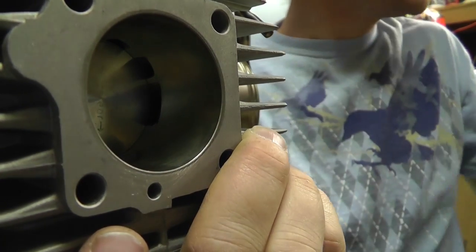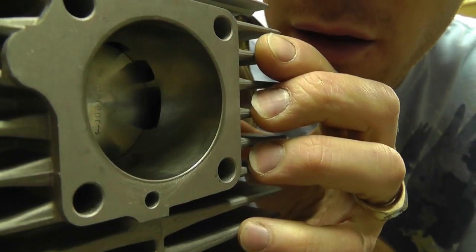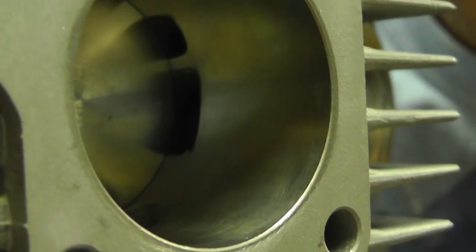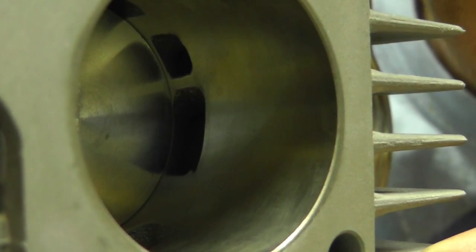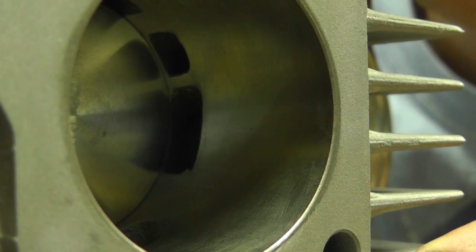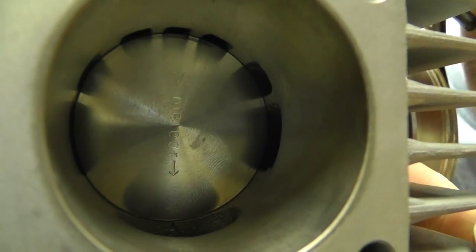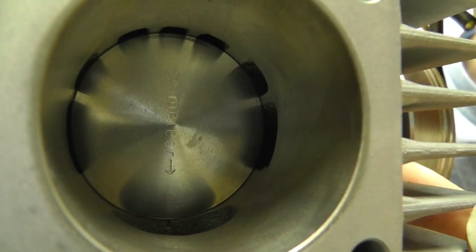As you can see — and I said I knew this buying it — this doesn't quite fit right. If I zoom in and get some better light in there, you can see: if I pull this out, see how it clears the ports. I need to come out almost a sixteenth of an inch to clear those ports. All of the ports are like that. You can see where the ports hit — I'm too far in for the ports to make it.